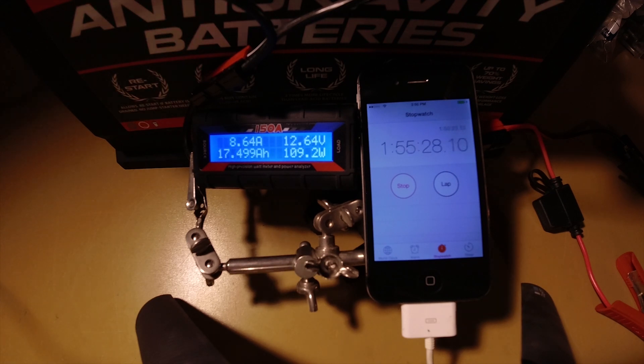Now that a lot of us are driving around with lots of LEDs, other vehicle accessories, and truck fridges, it's really important to try to monitor your battery and make sure that you're not discharging it too much. But if you do accidentally discharge your battery a little bit too much, you're okay and you are not going to be stranded. Basically, the BMS is monitoring the voltage of your battery, and if it sees that it's getting a little bit too low, it will shut down the battery and it goes into sort of a standby mode. Once you get back to your car, you can either press a button on top of the battery or click the included key fob, and it will turn the battery back on and it will have a little bit of reserve power to make sure that you can start your vehicle.